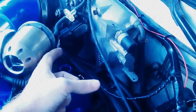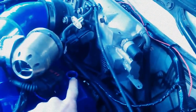Last thing, I don't know if I mentioned this in the other video, but my motor mount has been a pain, the one in the back. It was a pain to actually bolt that thing in, because I left the engine sitting in the car with the other 3 connected, and that one by the firewall I left disconnected. I need a K&N. I'm going to get a little K&N breather for that, or probably a little 7/8 elbow right there, and then a little 7/8 inside diameter coupler, and then put the K&N breather on the side so that it hangs off to the side, and that way it's not bumping the coil right there.